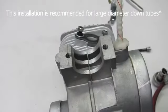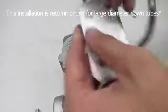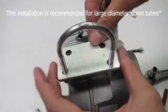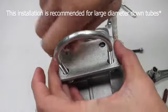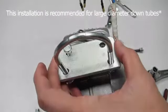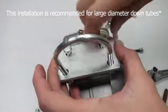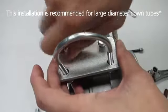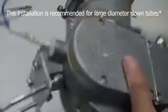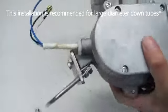Then, take an open wrench and torque the bottom nut to start removing the stud. Once removed, place the universal mount over the threads and install the bolts that came with the universal mount assembly. And that's it. Universal mounts are pretty easy to install overall.